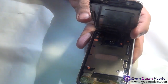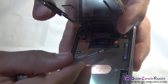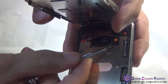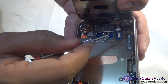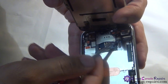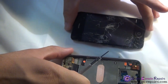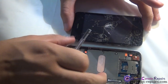There are three cables connected: number one, number two, and the third is the LCD cable. Use your pry tool or micro screwdriver to disconnect them. The LCD cable needs to be unclipped first, then slid out. Once done, the touch panel LCD assembly is separated from the bottom frame — set this aside.